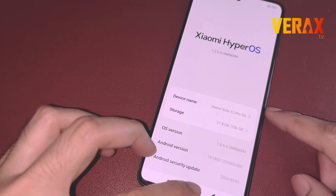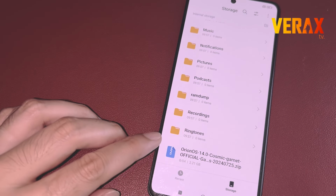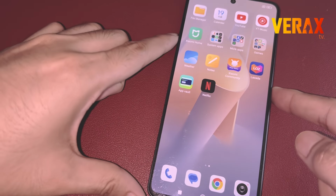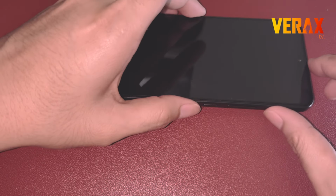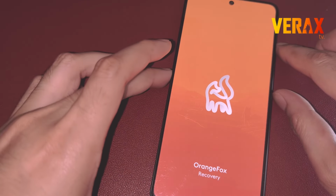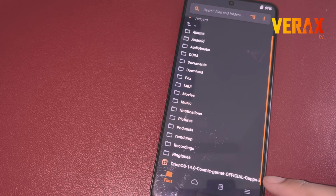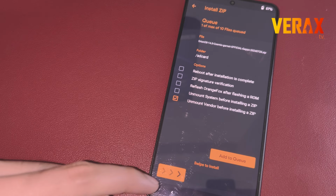To flash the ROM, you need to download the flashable file into your Redmi Note 13 Pro 5G. Download links are provided in the description box. Once downloaded, power off your device and boot to OrangeFox Recovery by pressing volume up and power button simultaneously until you see the OrangeFox logo. Inside the OrangeFox Recovery, locate the Orion flashable file you downloaded and proceed in flashing without changing any settings.